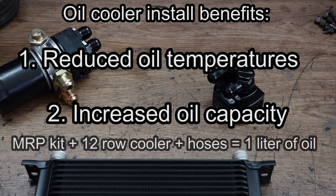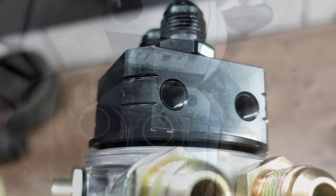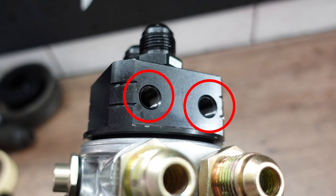This is definitely good because it helps keep temperatures in check and it's especially a good idea when you also need to feed a turbocharger with fresh, clean, cool oil. Something that I really like about the MRP oil filter relocation kit are these little markings on the housings — one, two, three and four — which makes it really easy to connect everything properly. One goes to two, two to three and three to four, completing the system. Another really nice feature are these twin ports on the oil filter mount. These allow you to install either temperature or pressure sensors, or you can use them to feed clean pressurized oil to your turbocharger.